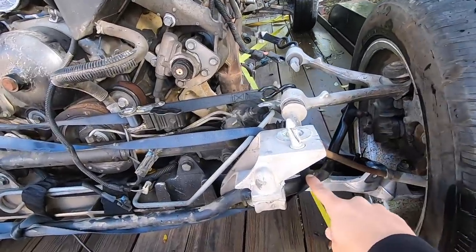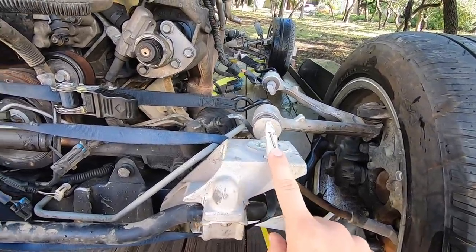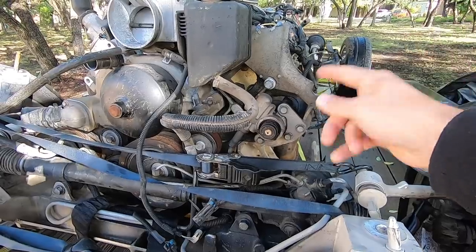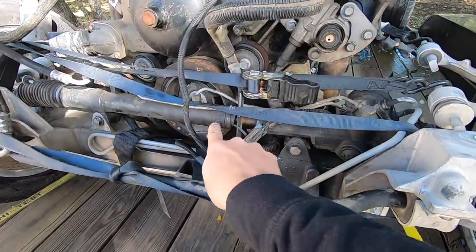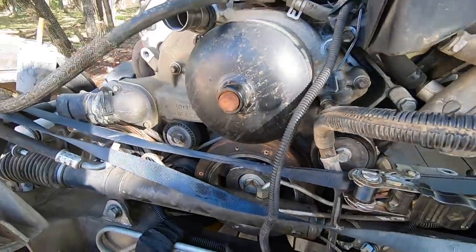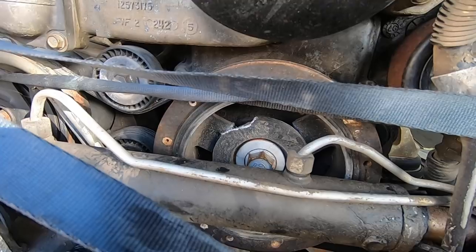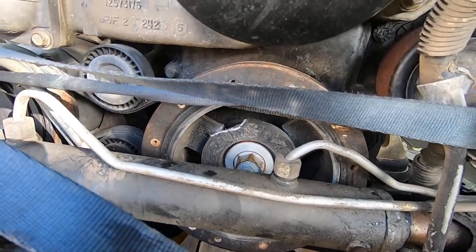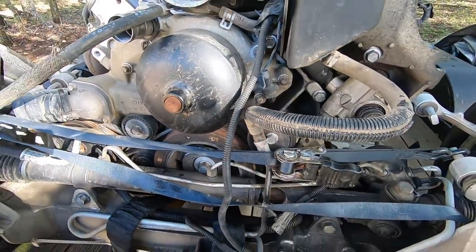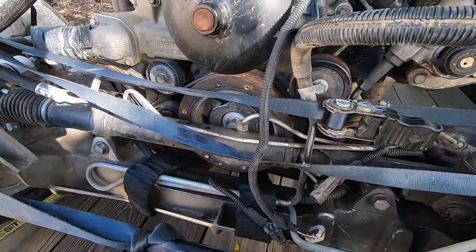This chassis was definitely in an accident on the front driver's side. I can tell from a few things — some more obvious than others. Our sway bar is bent right here, this locating pin that would go up into the subframe is a little bent, and some of the accessories are damaged on this side. This is normally where the alternator would be — it's completely gone. The power steering pump is broken, and the power steering rack is actually broken down here as well. The main thing I need to work on is the harmonic balancer — the actual crank pulley itself is broken off. That definitely needs to be addressed before we can try to turn this thing over. So we're going to start with getting the steering rack out of the way so we can try and pull off that crank pulley.